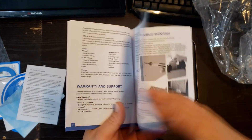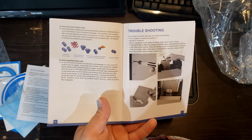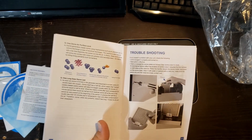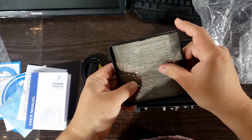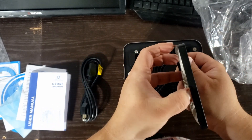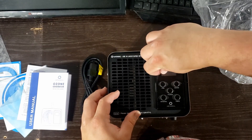The rest of the manual covers warranty information and FAQs. For maintenance, there's an ozone plate you may have to clean. Make sure the whole thing is unplugged and turned off, open it up, pop the ozone plates out, and scrub with a scrubbing pad that doesn't leave any lint - coffee filters or felt pads work well. There's also a pre-filter that's easy to pull out. You just clean it like an AC filter - I'd use an air gun for ease of use - then push the mesh back in and replace the cover.